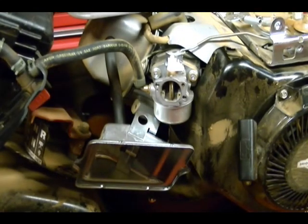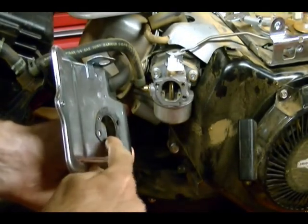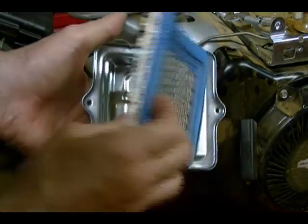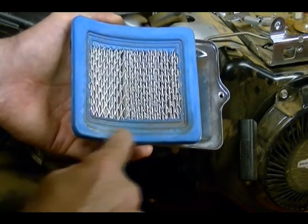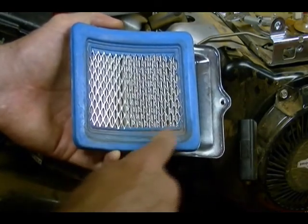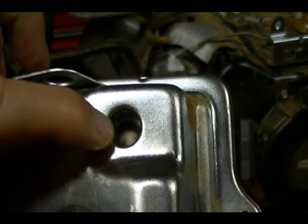I know that all my parts and my air filter are in good working condition and that everything was put together and tightened down correctly. The dirt isn't getting past the air filter from where the housing and carburetor come together because I'm getting an accumulation of dirt inside of the air filter housing. I noticed an accumulation of dirt at the bottom of the air filter and at first thought maybe dirt was getting past the bottom seam, but then considered that gravity might be pulling the dirt down inside the housing to rest at the bottom. If you remove this vent hose and look at the back of the air filter housing, you can see an accumulation of dirt inside.